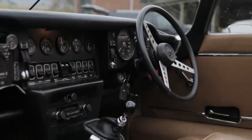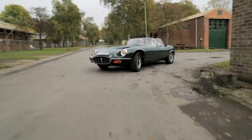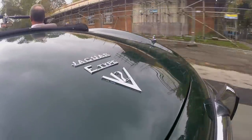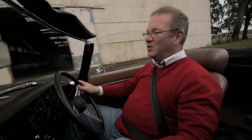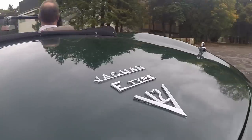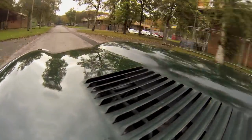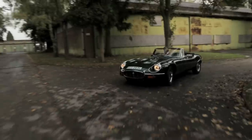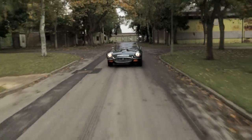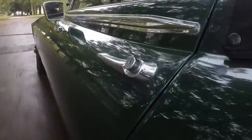On the test drive, you should feel one with the car. They are silky smooth. The rack and pinion steering is good and the performance should be effortless — they're a real grand tourer. Keep an eye out for whiffs of smoke from the back. These engines are very strong, but if they've suffered a head gasket failure, you might encounter a variety of familiar classic car woes. Be really aware that the rear suspension should feel nice and planted. If it isn't, you might have bush trouble or radius arm trouble. Take it on a reasonably long test drive; let it get hot if you can. As long as it feels centred on the road, you should be okay.